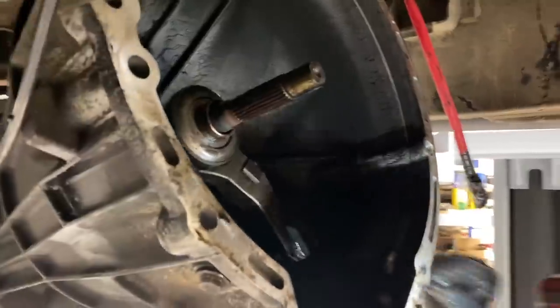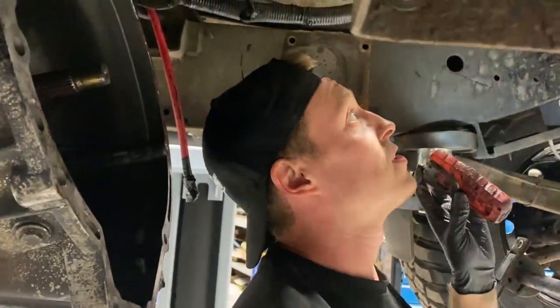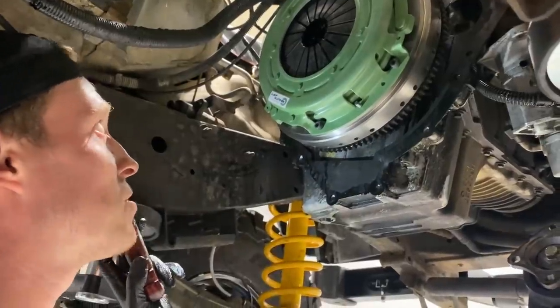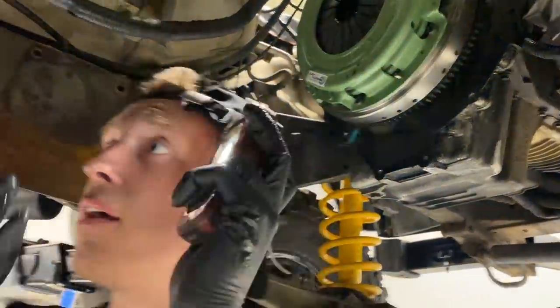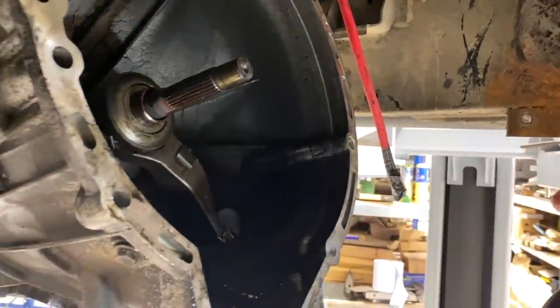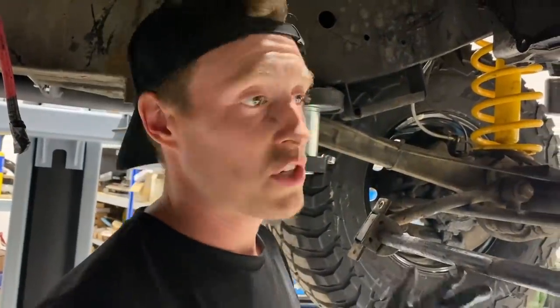Along smoothly, and that is our clutch job. Effectively, we've done the clutch. Now it's just reassembly. So we've got our power spec clutch, single mass flywheel conversion, new rear main oil seal, new clutch plate, extreme spec bearing, all the new rods, clips, everything. It's now time to get the gearbox, send it back home, bolt everything together, and make sure it all works.